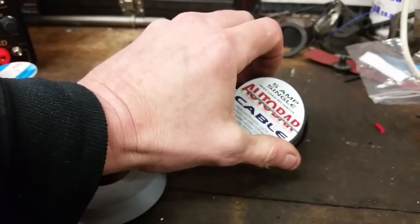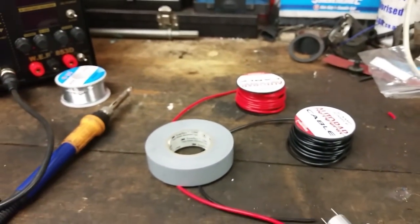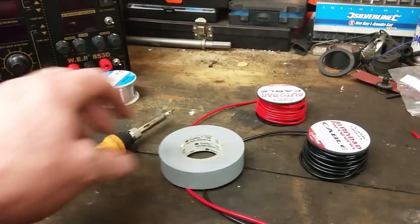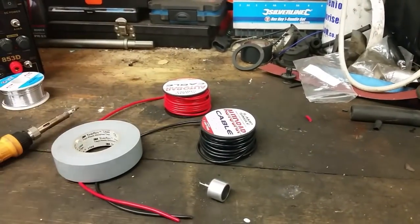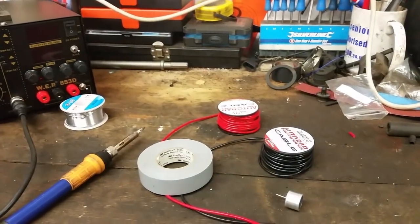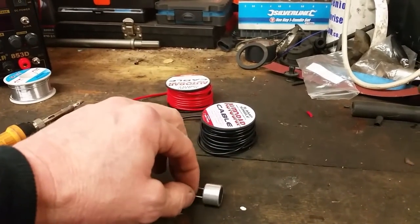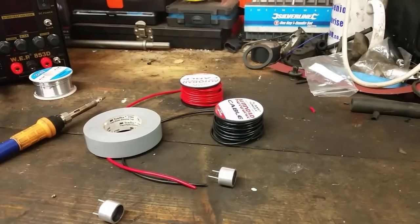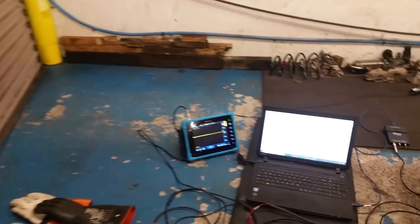The transmitter is no good to you — you get a couple of bits of wire. I just used five-amp wire, about 10 inches, get your soldering iron and solder to the wee pins. I put wee jacks in the end so it plugs into the scope cables. You need a good connection — if you put crocodile clips on, any wee movement at all is going to mess it up. If you have a better scope than the Pico 2000 or an automotive scope, it'll work great.